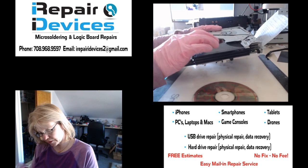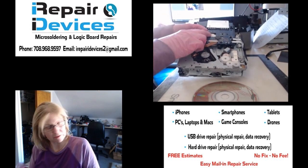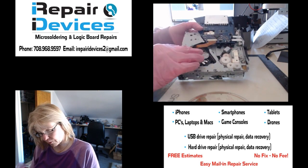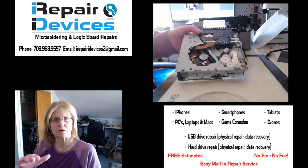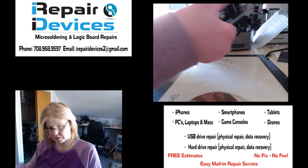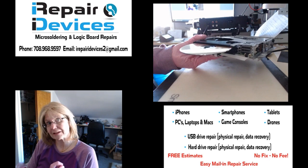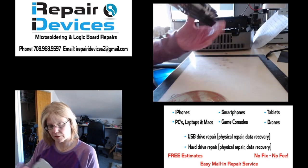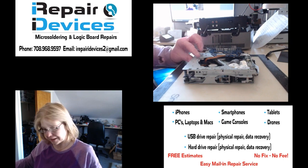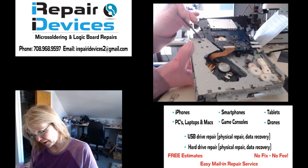This is where your CDs are fed in — you can see each one. Each one has an arm here. When I flip it over, there's a clutch here. This clutch controls the whole assembly and transfers power to the rest of the assembly, which controls the unit going up and down. When the clutch is in the disengaged state, it means it's loading the CD. So when I put the CD in the slide, this arm is going to pull in the CD and put it into place. Once the CD is loaded, the clutch goes into an engaged state, and it's going to transfer power to the gears.